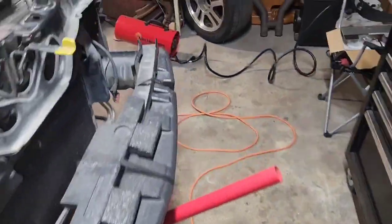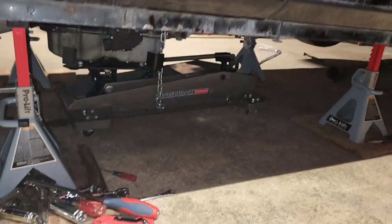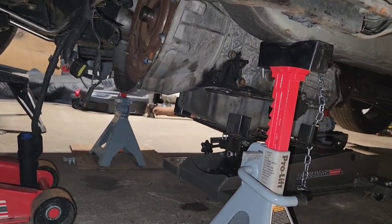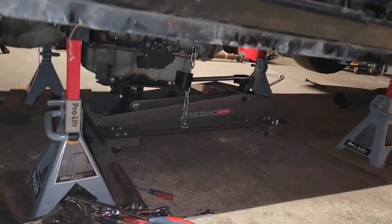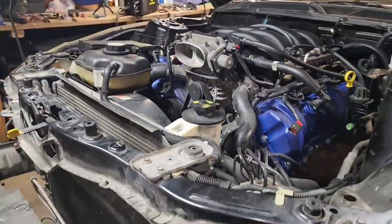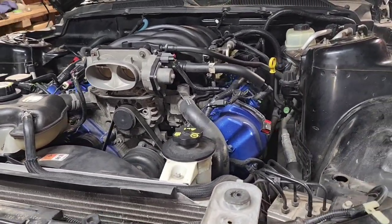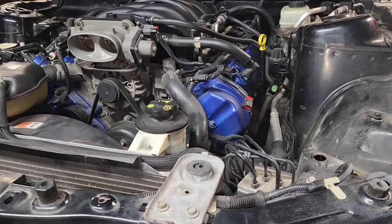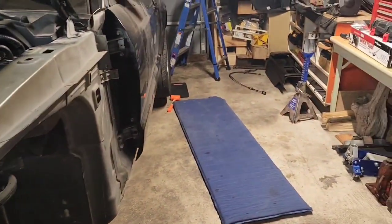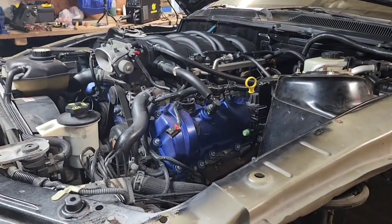I'm going to go ahead and end the video here. I have to figure out some way of getting this out from underneath the car — my jack stands just aren't tall enough. I measured the bell housing at 17 inches, plus the height of the jack, so I went online and ordered some 6-ton jack stands that go up to 23 inches. A lot of people online make it seem glamorous to work on cars — it really isn't; it's frustrating, especially when you don't have the right tools or you're having trouble getting something apart. Anyway, let me know in the comments whether you think I should fix this tranny or do a manual swap. Like and subscribe — peace out.